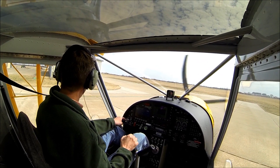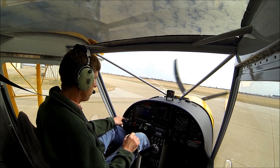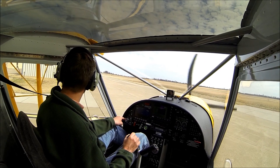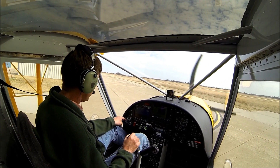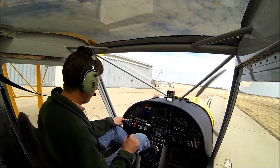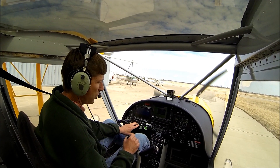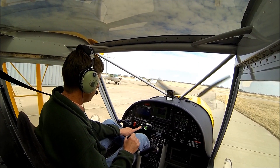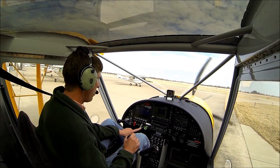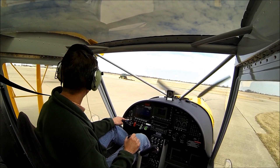I went up to BC and did the first flight back in November with this new 912 IS engine. I flew it for about seven hours and it was flawless — we did not have one squawk and it just flew beautifully. I've got two alternators, two ignitions, a main fuel pump, a backup fuel pump, and backup sensors on there. So everything is redundant.